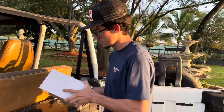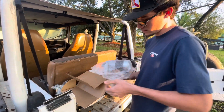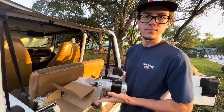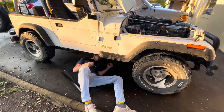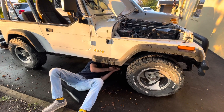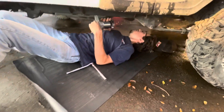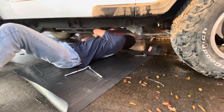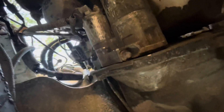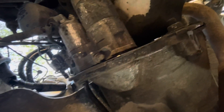Okay, so if you're looking here - that's the starter. I'll take off those two terminals right there and then this little thing right there, and then take off the two mounting bolts and it should come off. It doesn't look the same because I have this little nick here but it should be the same.